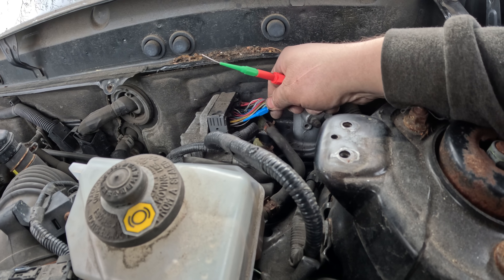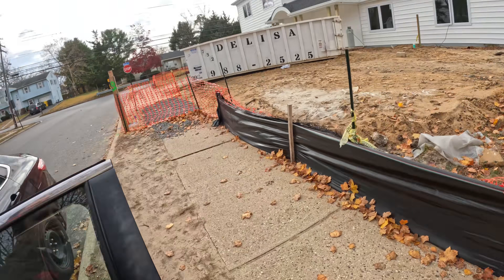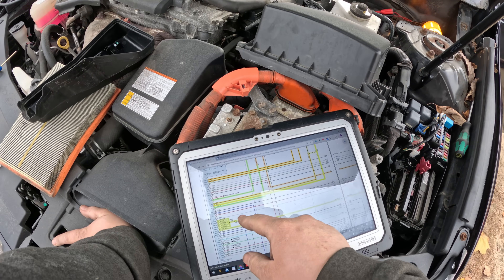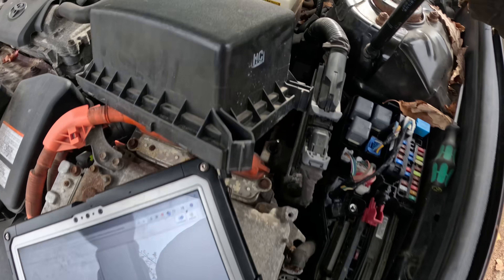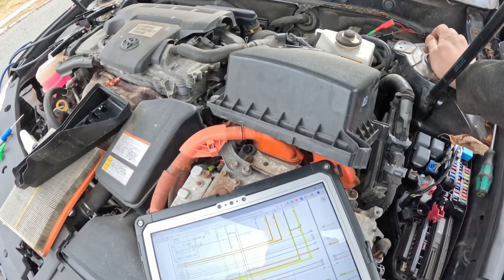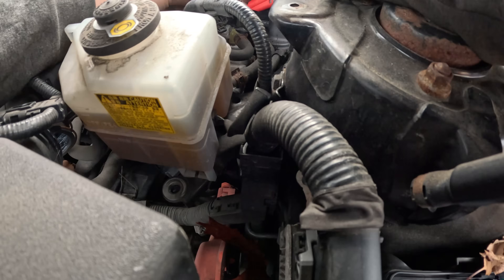This is only going to be live with the ignition on. Wait — is the ignition on? The ignition is off. Let me check — I'm looking at pin 20 versus pin 15. I had it on an always-hot pin. Now let's check the other one — pin 14, one pin over. It's a pink wire — let me make sure I don't ground anything out. That one's good. So we have four powers confirmed good so far. Now we check the ignition-switched ones: pin 16 and pin 12. Let's turn the ignition on.